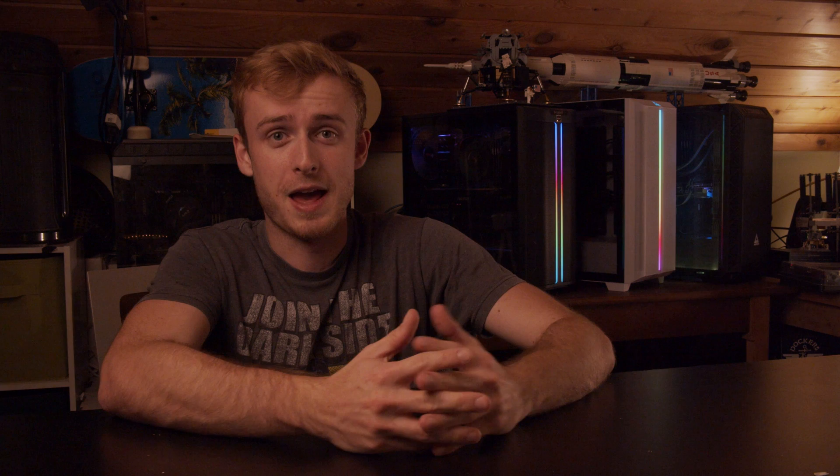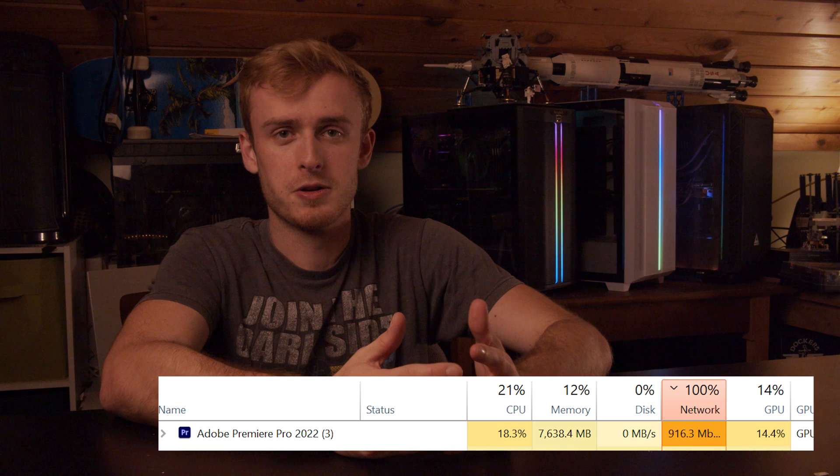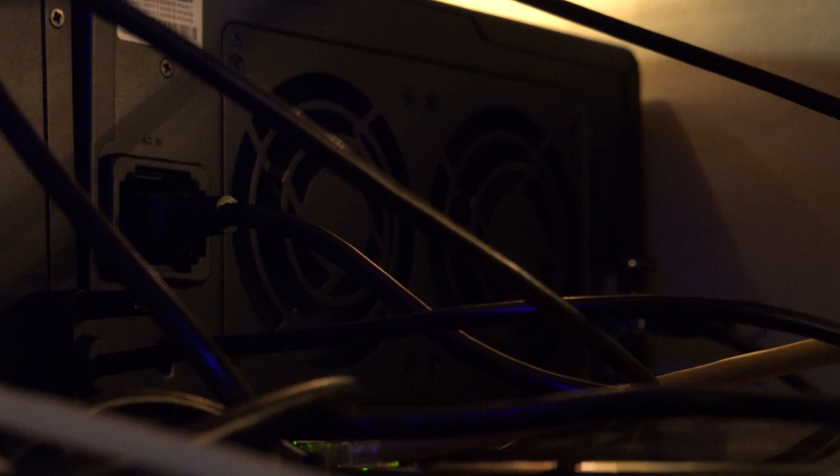Four guys total trying to edit content in a timely manner and work together — I need to view and access content from different machines. That means a NAS is practically a really good option. A couple things that are important about video editing: it requires a massive amount of bandwidth, because you need to be able to read and write to drives, especially when you're editing 4K content, which this channel has been doing for almost three years. Editing 4K content is very bandwidth-heavy and requires high-speed drives. We're talking 10-gigabit cards installed on everything here, so that multiple people can be working on the same server at the same time without any bottlenecks.